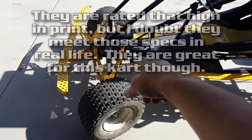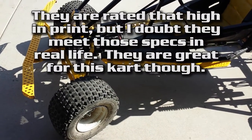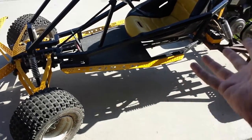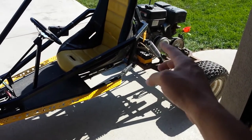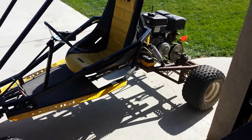And then I actually moved the rear shocks to the front, but that was a little too tight. You could probably go with a 10-inch shock instead of 11 or whatever that is. But this cart sits up well and takes the bumps quite well now, especially back here. We never bottom out like we were before, and it rides really smoothly.